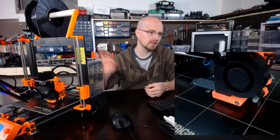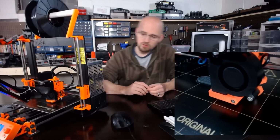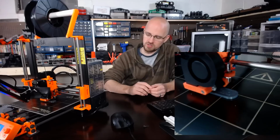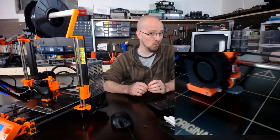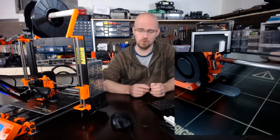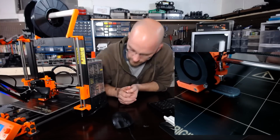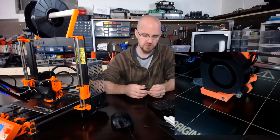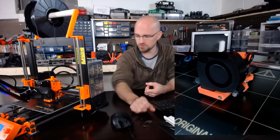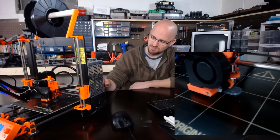Yeah, Aaron's talking about how many 12-volt rails this has. I don't know what format of power supply this is. I know for computer power supplies, unfortunately, one is the standard to have one 12-volt rail. So I don't know how many that has in it. You could pull the spec sheet up, but I don't know where the part number is on this, or who the manufacturer is.